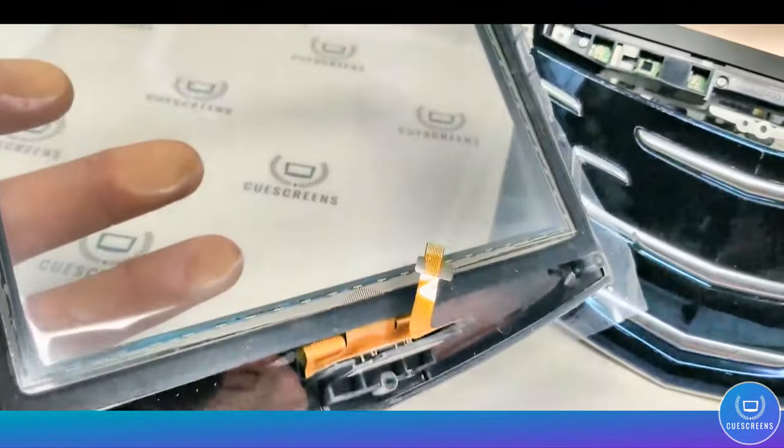Here's an example of where we're trying to get the screw in but the hole isn't large enough to be exposed. Instead of fighting with it or trying to get it at an angle, just leave it out and move on to the next one. As you can see, it's not quite half the hole exposed, and forcing it would be too much of an angle and could crack or cause binding — so leave those screws out.